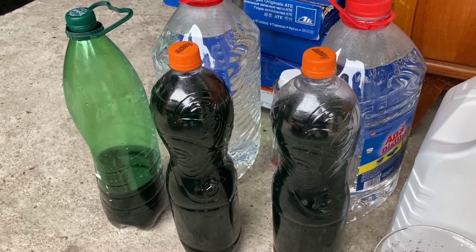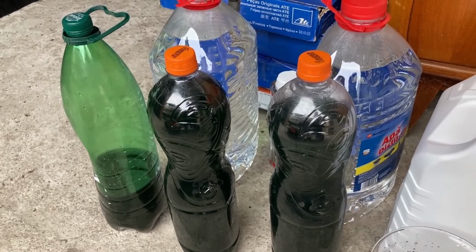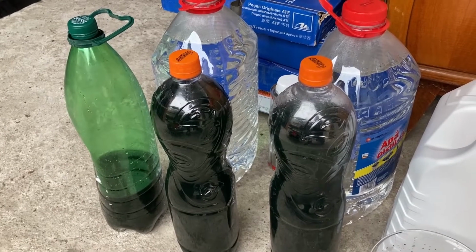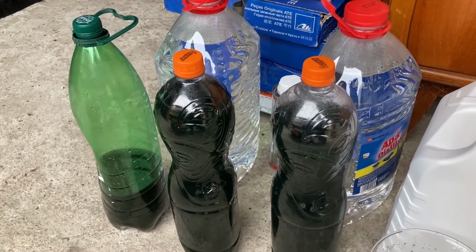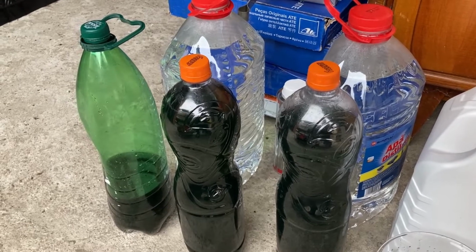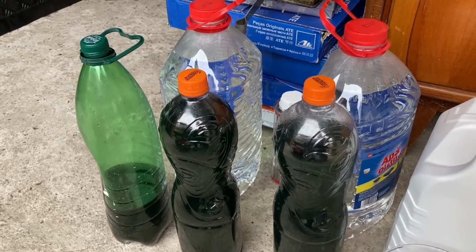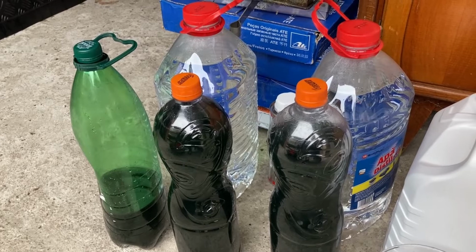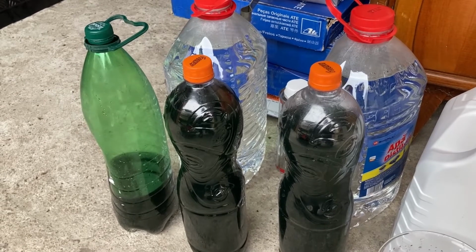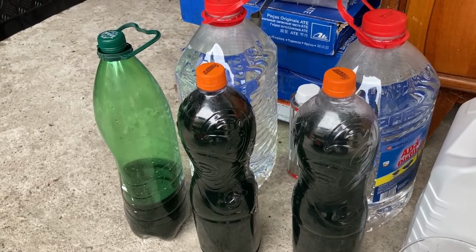Now, what does the next step imply? Well, I'm simply going to do a number of cycles where each cycle consists of me adding pure distilled water to the radiator all the way to the top, then driving the car for a while to make sure that the new water mixes with whatever old coolant is still inside the system. I am going to drive at least until the car reaches the operating temperature, plus some additional 10-15 minutes. Then drain everything and repeat as many cycles as I need until what I drain looks about as clean as the normal distilled water.